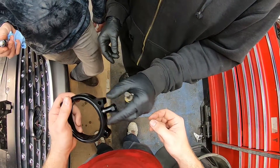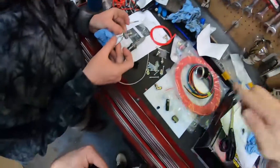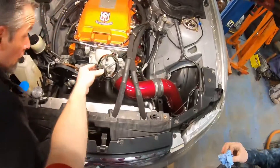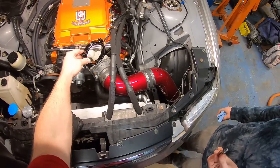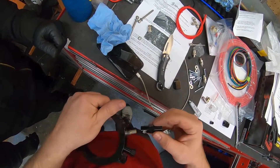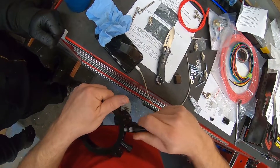What I decided to do myself was the installation of the throttle injection plate between the throttle body and the supercharger snout. This was a bit of a learning experience because the nozzles and nozzle holders that come in the standard kit aren't actually compatible with the injection plate. Well, the nozzles are, but the nozzle holders aren't. They require a straight-through nozzle holder rather than the L-shaped 90-degree block-style nozzle holder that comes in the base kit.